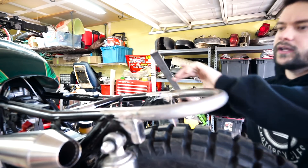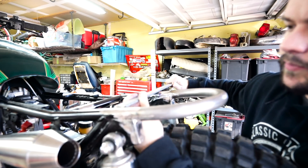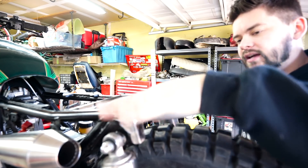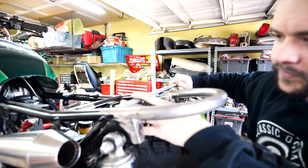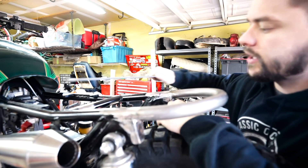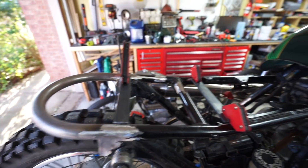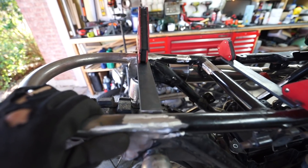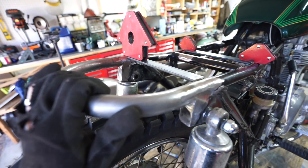This is the bar stock I'm using — it is probably quarter inch thick, so it's very stout, especially over this short of a span. Basically all I'm going to do is put this across here, mark where I want to cut it. The idea is we want to weld it in so it's basically flush with the top — we don't want it sticking up — so we don't interfere with the clean fit for the seat itself. We'll cut these two out; the front one's cuts are going to be at a little bit of an angle, but nothing crazy. We'll cut them out, grind the paint off, and get ready to tack weld them in. Got my two bars made up — sitting flush with the top of the frame like we mentioned — and I'll go ahead and pull out the MIG welder and give us nice four zaps across here. Then we'll move on to drilling the holes in these to match up with the holes in the seat.